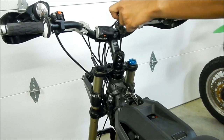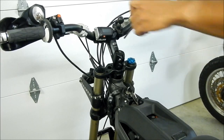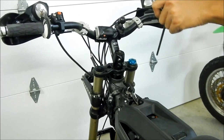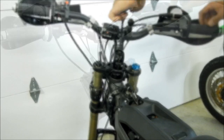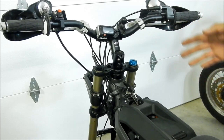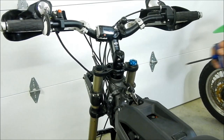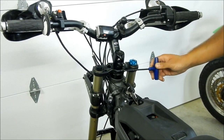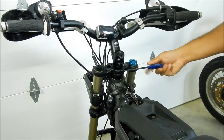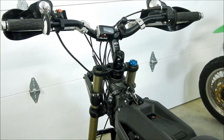It's too tight again. Make sure it's too tight first — see, it's kind of just staying in position. Start loosening it. What I would do is make it tight and then back off — that's the best thing to do. Then go ahead and tighten the upper clamp, which pretty much locks your setting in. That's the rear bolt.